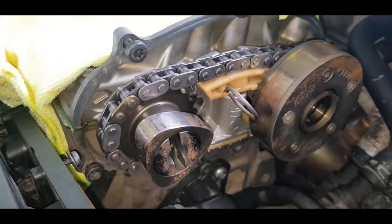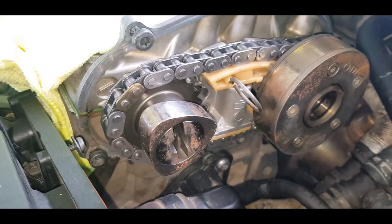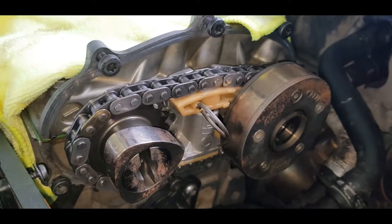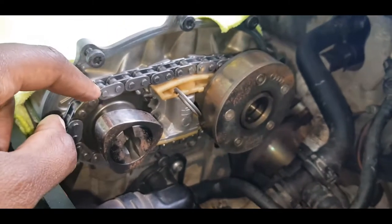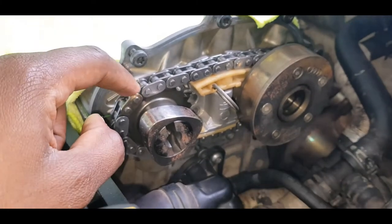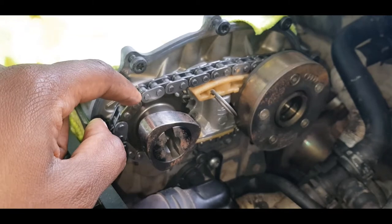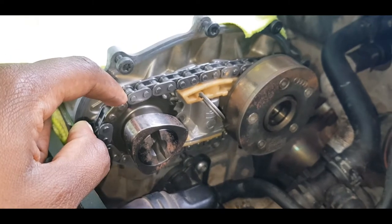I haven't even bolted this in place yet. So what had happened is, because the timing belt had broken, I had simply pulled off the head, taken out both cams, and had all 16 valves replaced at a machine shop. I had the head skimmed, reinstalled the head, dropped the cams in, and then tried to link these together using the 19 link rule between the timing marks that I am seeing on this particular forum, but that just has not been successful.